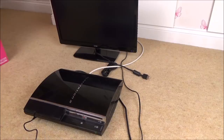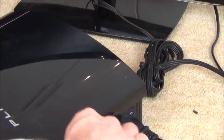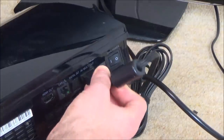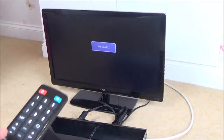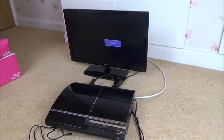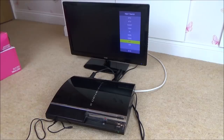Because we might not be getting display due to the HDMI cable being plugged in, let's plug in the AV cable instead. I've already got an AV cable in the TV, so I'll plug that into the back and switch to AV input. Still no display.